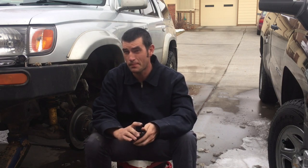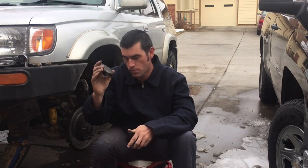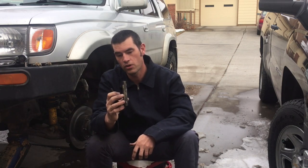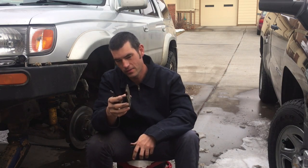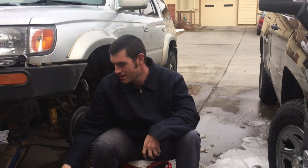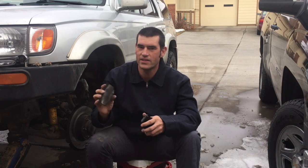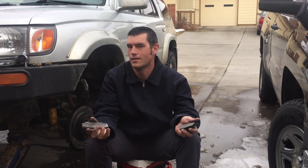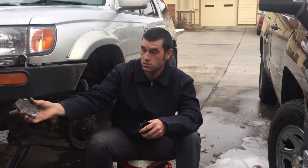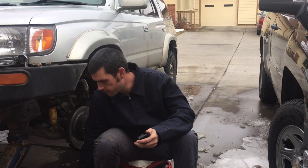The third con is not having a clear warning when your pad is running out. I checked these about a month ago and this outside one lost 3/16ths more material than the inside one within about two and a half to three weeks. They don't always wear evenly, but losing that much that fast was disappointing because I didn't know it was happening.